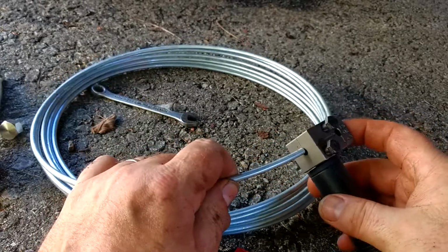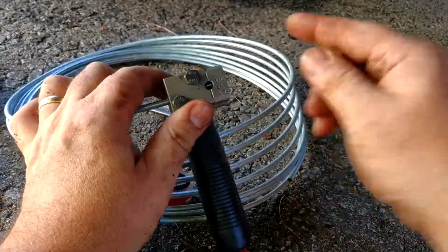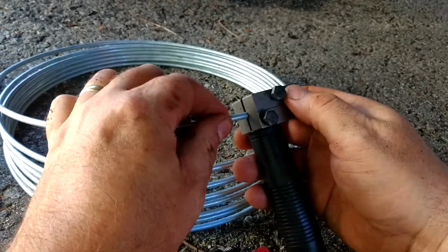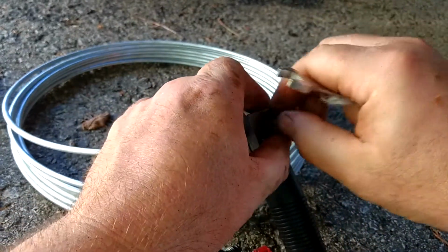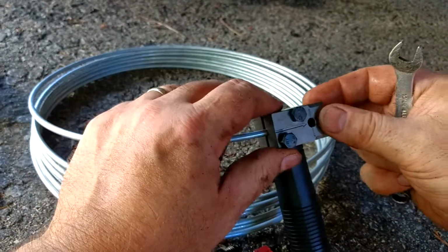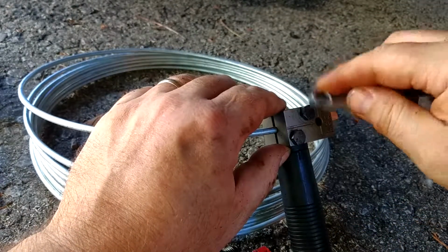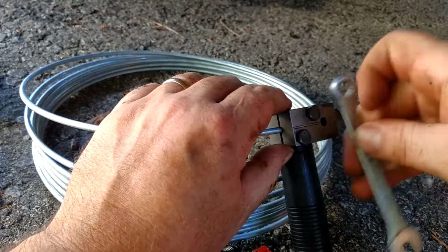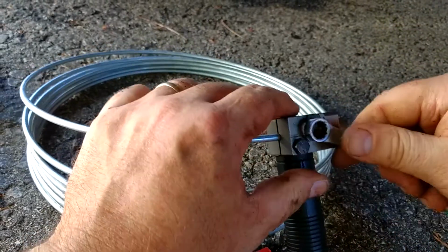So using this, put that in there with this fancy tool. It came with a couple dies, so you screw the die in, put the brake line in until it hits, and tighten a snot out of these 10mm wrench nuts, bolts. So push the brake line all the way in so it hits the stopper. And tighten these. I alternate, and once it starts getting snug, I'll start snugging up the other side and go back and forth. Make it as even a squeeze as possible.